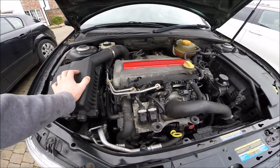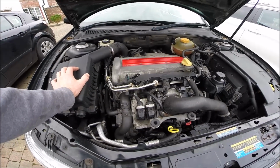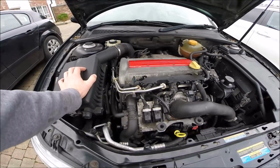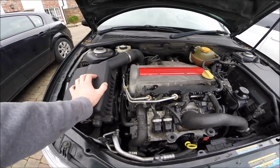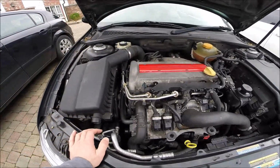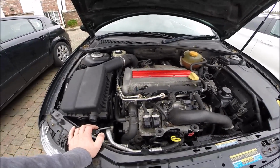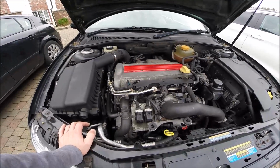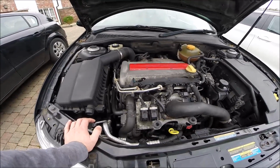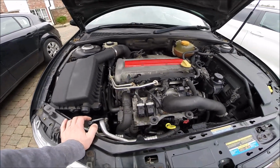There's no error, because the ECU still tries to correct this, but usually it should be without any fan or anything in the car. When it's switched off, at idle, a warm engine should be around 10 degrees. Mine is 25 to 35, really high, so it looks like the ECU is trying to fix the ignition point.